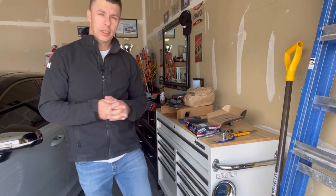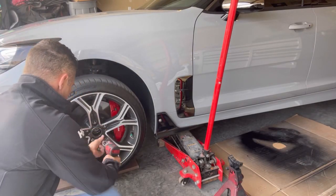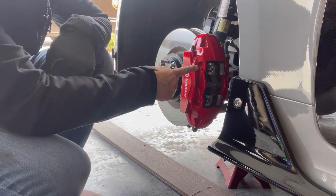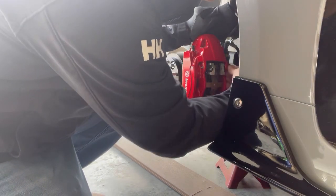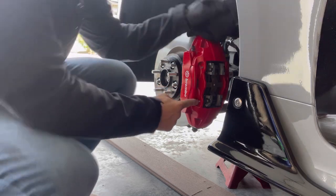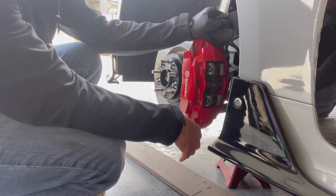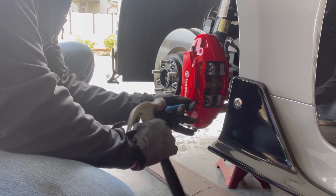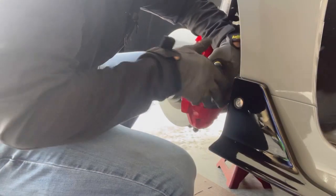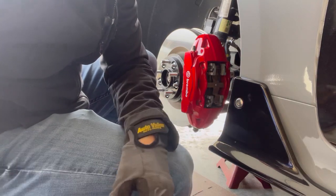Time to jack this car up. On these pads, if you look close you'll see a pin on the backside. There's no retaining clip on these pins — you're just going to want to softly tap them out with a little punch. Take some pliers and try to get the backside out. There's one pin — just set that aside and don't lose it.